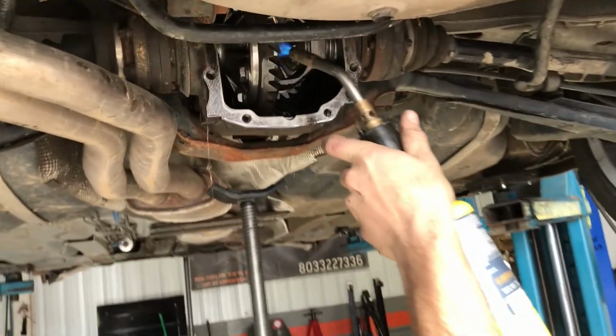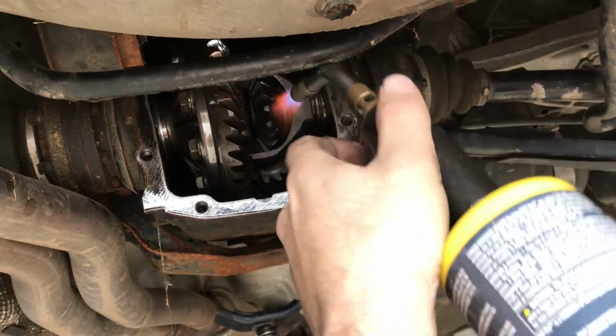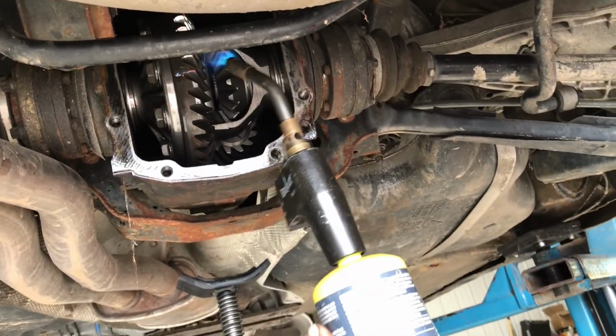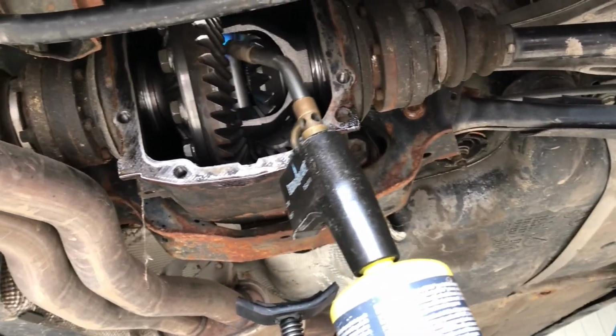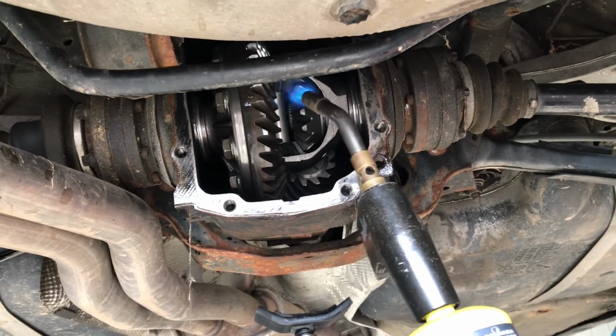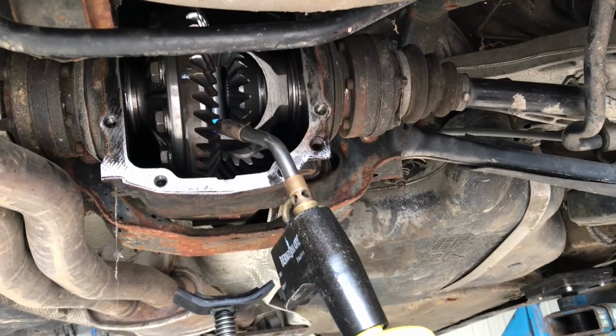All right, so good. We dried it out good enough, no flame. Usually it goes woof and blows up. We're good. I normally just preheat these gears a little bit. You don't have to go very much with it. But sometimes if it's not clean enough, you'll heat it up and you'll start to see gear oil run out, which is not good for your weld.